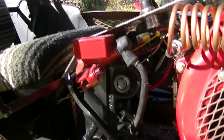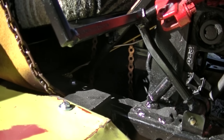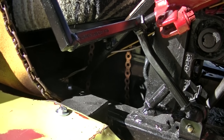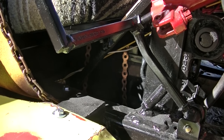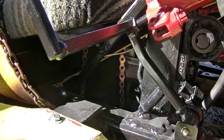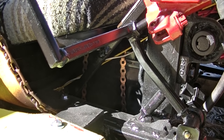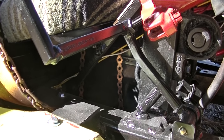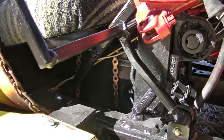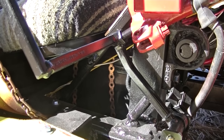I had some people inquiring about the battery, and it is so buried, there's not much chance of seeing anything at all. But if you see that copper strap there, there's actually two. That's the battery kind of hiding under the control panel, under the seat, and behind the jack shaft. That is a 12 volt 25 amp hour AGM that came out of one of those battery boost boxes. I had this boost box for years. That battery's probably 7 or 8 years old now. It still holds enough juice to get this pig started, which is great.